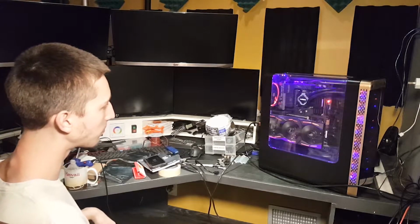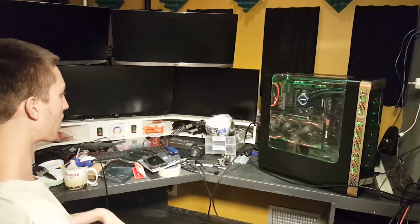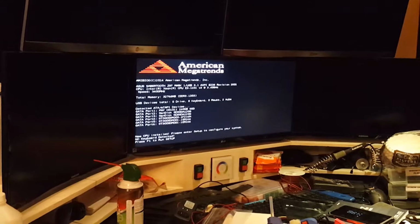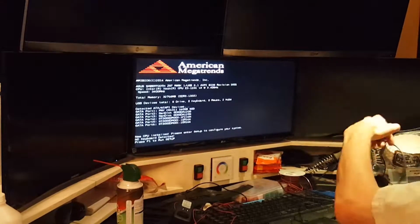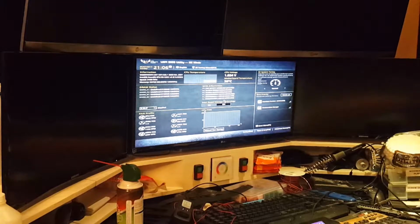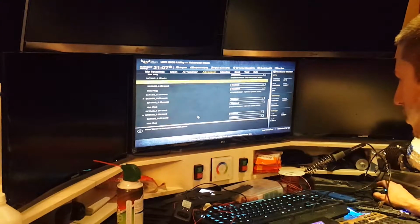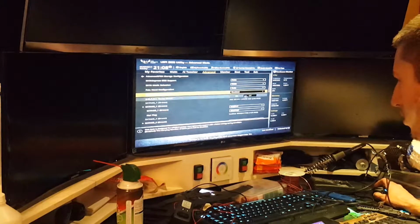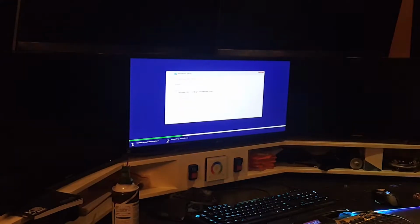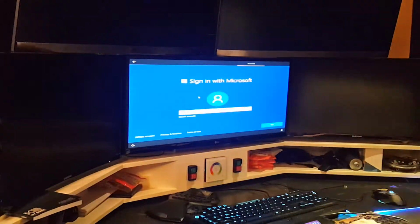Finally, we're done with the building, but first was the ever so fun first time boot up, and as always, it booted the first time. We move on to the installation of Windows, which is always fun, right? First, I had to set up the storage arrays. Now for the boot partition, which is the 3 SSDs from earlier, I had to enable Intel's RAID controller, then set up the RAID array via Intel's RAID boot menu. The storage setup for the hard drives would be done later in Windows. Once completed, it was time to install Windows itself onto the boot partition. This was accomplished via a USB flash drive installation.